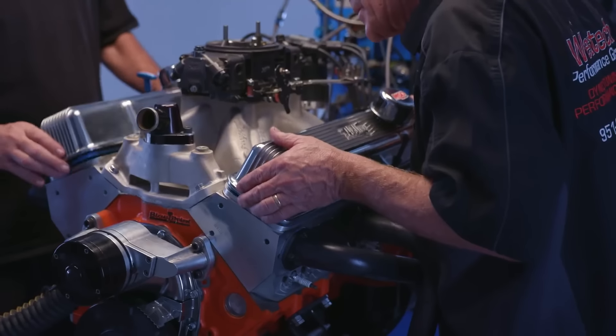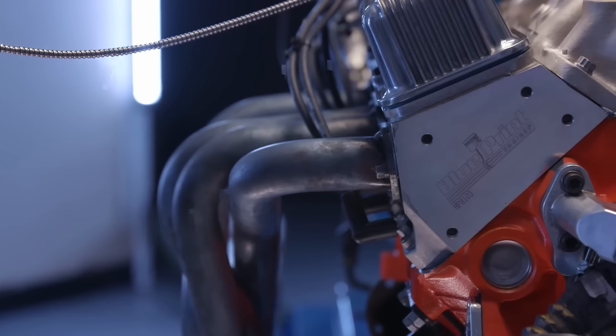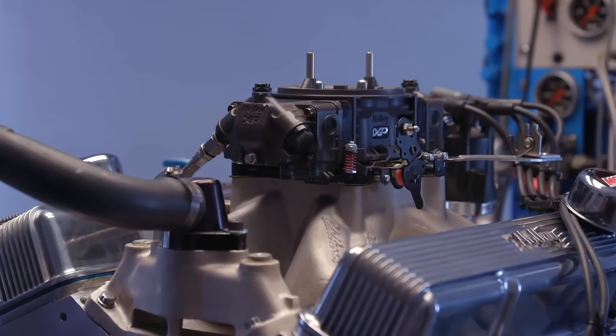So are we done? Let's go install it. Steve and I are changing the cam. We have the roller cam all installed now and ready to fire it up. It's going to make more power, but there's no reason to assume it would take different ignition timing. The jetting will probably sort itself. The timing is going to be pretty much determined by combustion chamber, dome, and cylinder head.